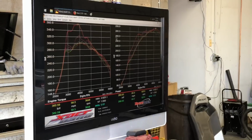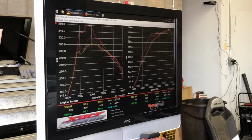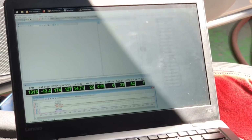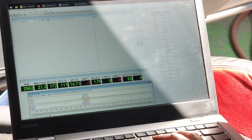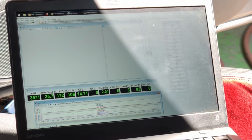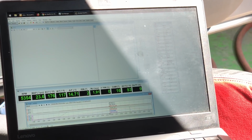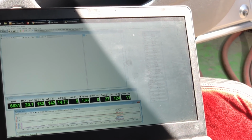All right, guys, so taking a look here after the first flash, you see it picked up about 60 torque with 5 horsepower. And after looking at the intake temps right here, we start off with just sitting, so 127, but nothing's really flowing through it. As you watch, now we're flowing through, the intercooler's doing its job, charge temps coming way down. We're getting close to peak boost. So it looks like 106 is our best number, and then that's where our problem is. We start to climb, and we get as high as 144 by the time we're done.